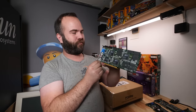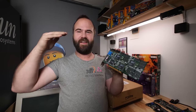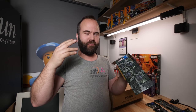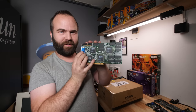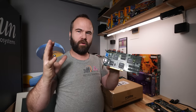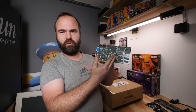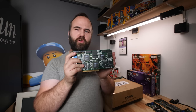The Voodoo 2 is my favorite Voodoo solution because if you use it you still have a lot of choices for 2D cards. With an AGP card you also get fast 3D support and good 2D quality, and then you add the Voodoos next to it. A non-3DFX card has DirectX and OpenGL, and the Voodoo 2 adds Glide support for games that support it — the proprietary 3D rendering solution of 3DFX. It's the best of both worlds, and the performance of two Voodoo 2s is really good.